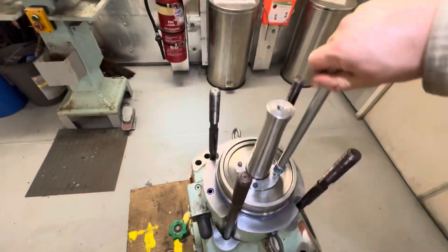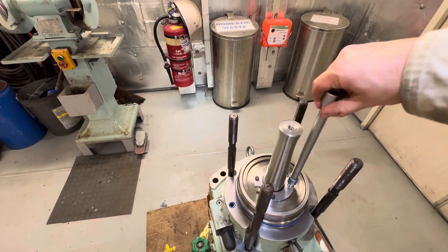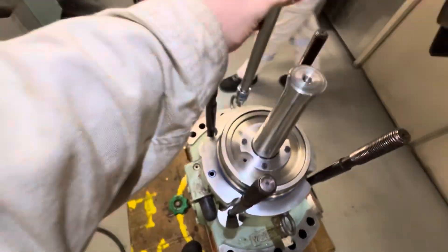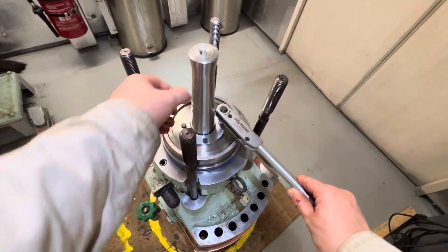These are M6 bolts — check the manual. For these bolts you can use a torque wrench; the torque is very small, about 15 Nm. For each engine type it will be different, so always check the instruction manual for all data.